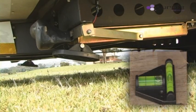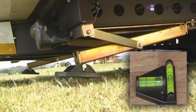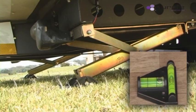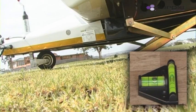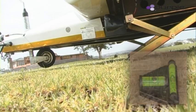You will see that the caravan front legs will go down first. This is important — always try and keep your nose lower than the backside of the caravan. That will force the front legs to come down first. The front legs will find ground, then they will lift the front until the whole caravan is level.